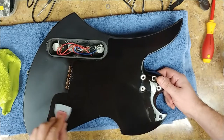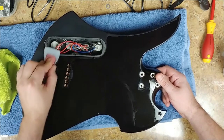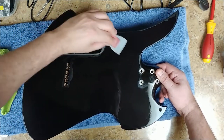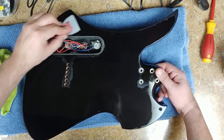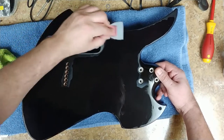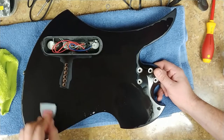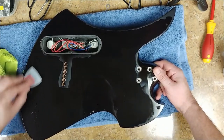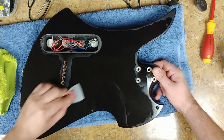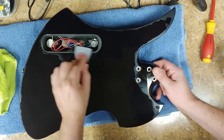Welcome back — I'm still doing a little sanding here. I've got the 3000 grit sandpaper and have been over this thing about four times already. Knocked out some of the dents that were in the clear coat — thinking maybe those were something in the clear, not physical damage. There are a couple of spots I couldn't fix; not too worried about it. The 3000 grit sandpaper is working just the way it's supposed to. Again, when you are doing something like this, you want to be careful you do not go through the clear or the finish.